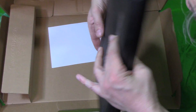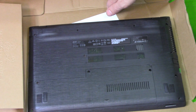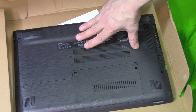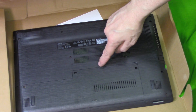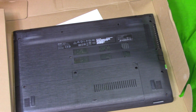You'll also notice on the bottom — and I'll spin this around — there is a compartment. If you can see, there are three screws. This is how you get the back plate panel off to get at the memory slots and the hard drive. Also, there is space to install an M.2 SSD hard drive. I don't know if this one shipped with the installation screw for that. But when we open it up in the next video, we're going to show you how to install 8 gigs of RAM into the open slot, giving us a total of 12 gigs.